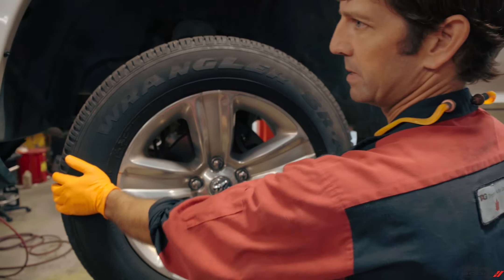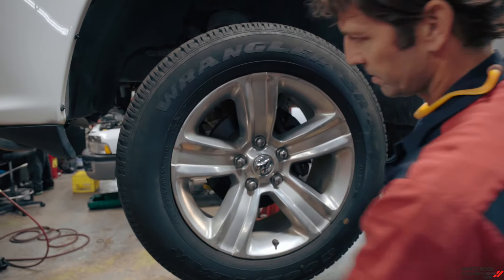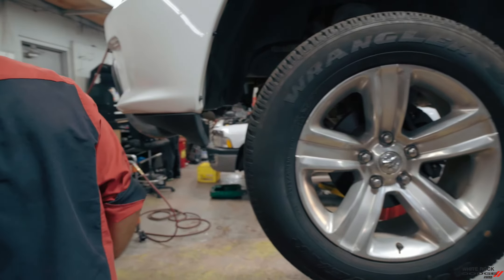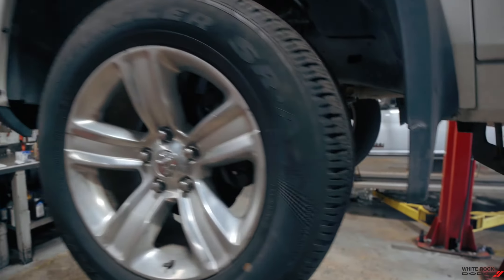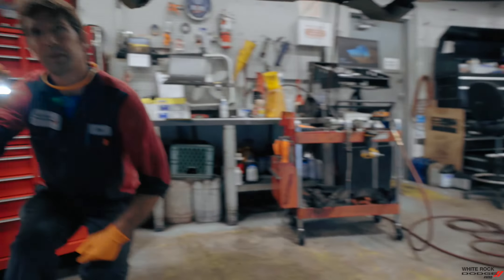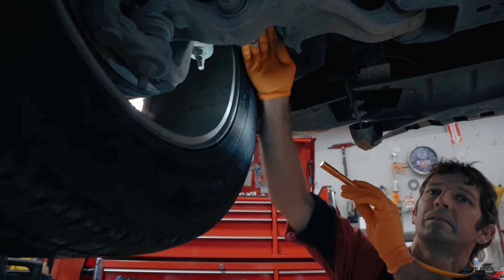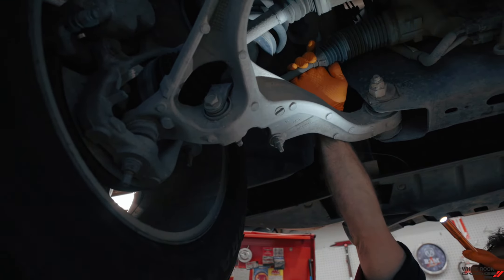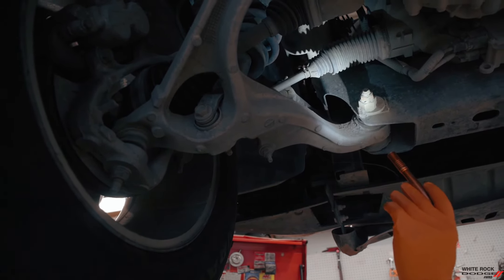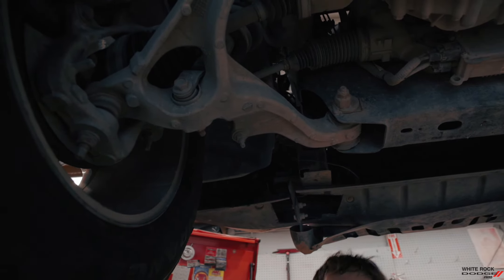The other thing we do over here is we'll give the tire a shake. This one's got a noise in it — I'm reckoning it's got a tie rod with play in it. Good thing we have an assistant. Hey JJ, can you wiggle this tire please? Come on this side actually. So we checked the outer tie rod — that one's pretty solid. When we tug on the inside one it kind of goes away, so the inside tie rod is the one that has play in it. Thank you, JJ.